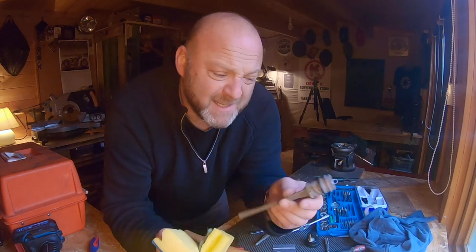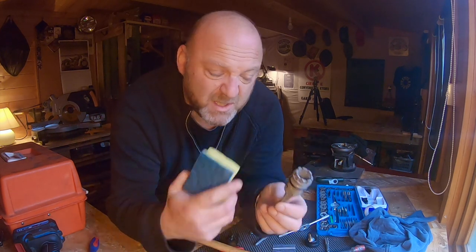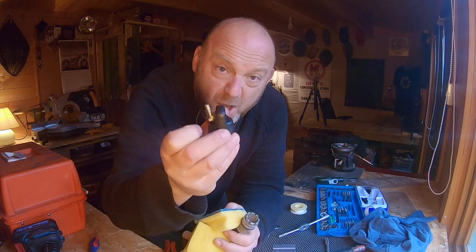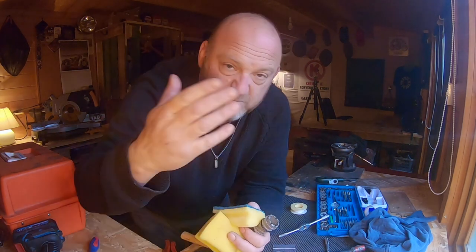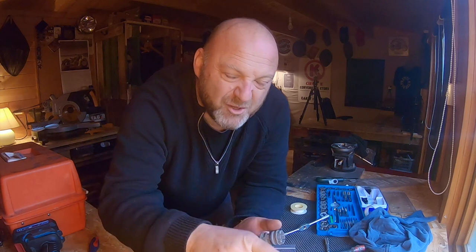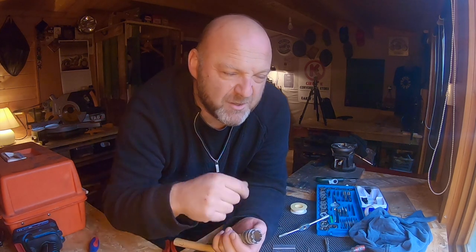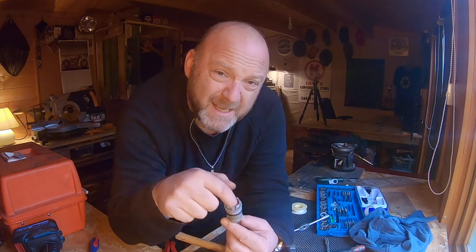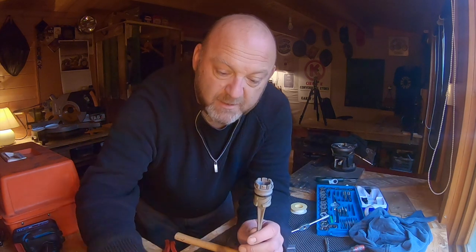The next thing to do is seal up your dipstick. You've drilled your holes at the bottom - two, three, four, however many you want - and tapped your cap with some kind of hose connector. It's a real faff; if you're not sure, get somebody else to tap it properly. Don't feel tempted to drill a bigger hole than the actual fitting itself because you'll have too much of a gap. Try for that painstaking process of threading it through - it'll be a much tighter fit.